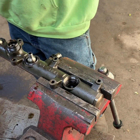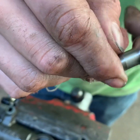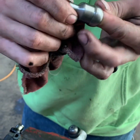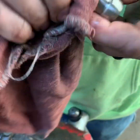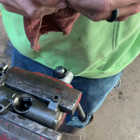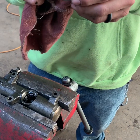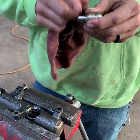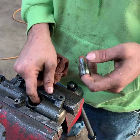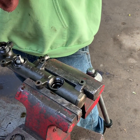I don't like this one — it's got a neck in it and still has a little bit of a groove. I'm going to see if I can find a good used one around here because I don't trust that one. If you look real close at it, there's some pitting in there. That pitting can cause a leak — if you get a little bit of a leak behind one of these O-rings, it'll end up being a major leak because of the tiny size, just like the end of a nozzle on an injector. So I want to switch this out. I do have a spare 6.0L motor in the other building, so if it comes down to it I'll just rob one off that motor — perks of having a bunch of used parts laying around. I own two of them.